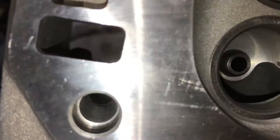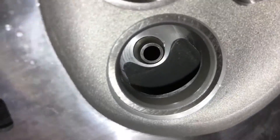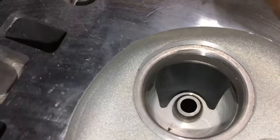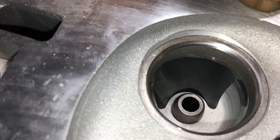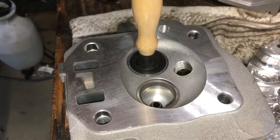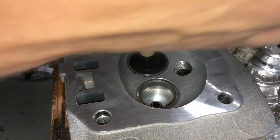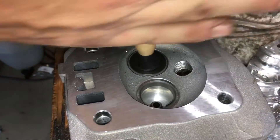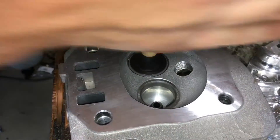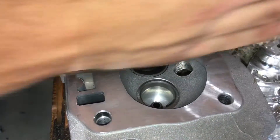And here inside the head, see the same thing again there on our lip, and we're good to go. Here you can see where this side is not done — it's got that little lip in there. Now I don't know how well this audio difference is going to show up, but as you're close to being done with lapping in, that hard grinding sound will go away and you'll get a much smoother, more metal-on-metal sound. Hear that? That means we're just about done.